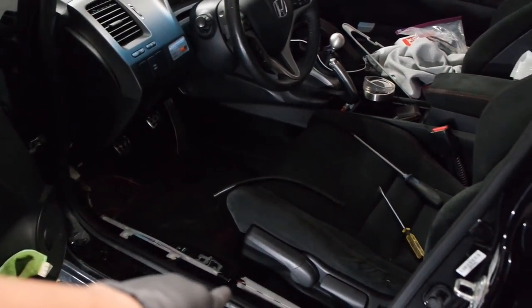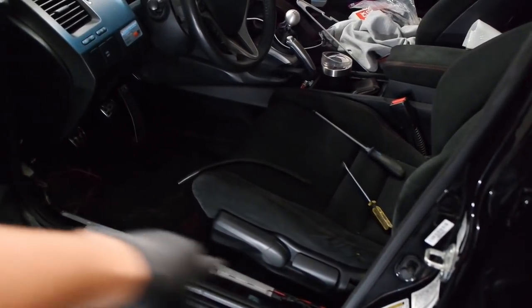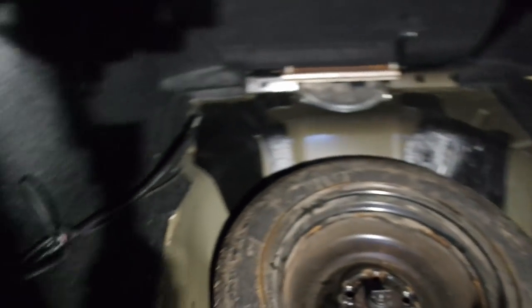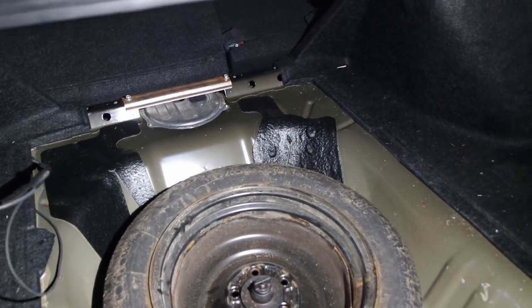The fender comes out right by the clutch pedal and fuse box. What we did was take apart the paneling — there are white plastic pieces that hold the stock wiring — we opened those up and ran the first part of the harness inside those white plastic pieces. Then we ran it through underneath where the seat is, right into the trunk.